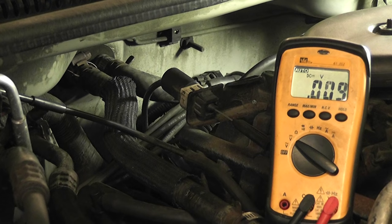What we look for generally is less than 100 millivolts on a sensor ground. One of the things you want to understand when you do sensor ground testing in a cranking condition is that you're going to have higher voltage during a crank than with the engine running or with just the key on, engine off. That's because the starter draws a huge amount of current and loads the block with a lot of energy. You're going to see an initial spike — that initial surge of current from the starter loading the block. I'm okay with 200 to 300 millivolts on an initial crank.